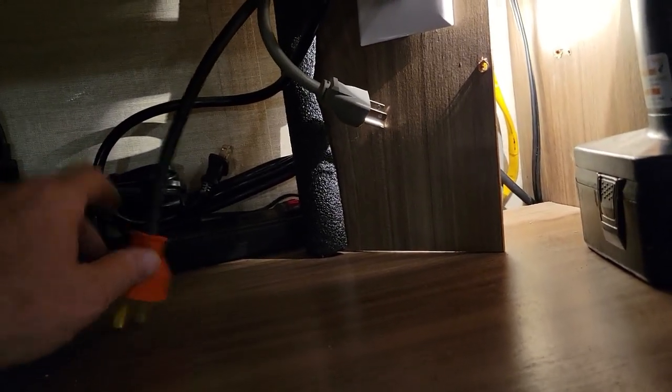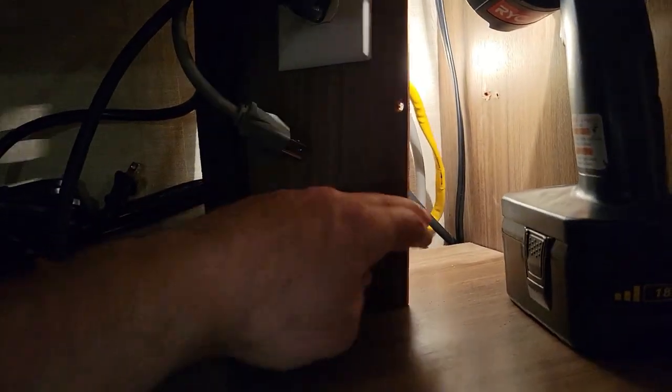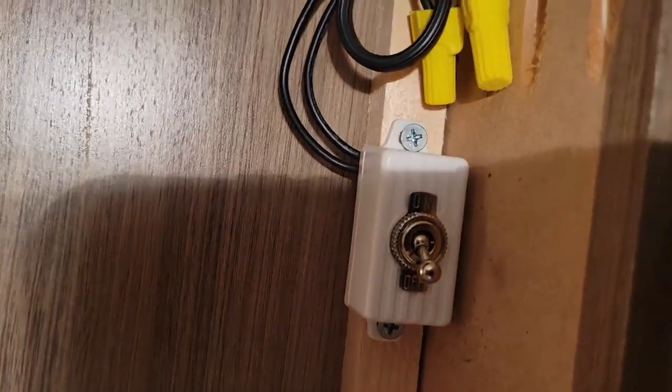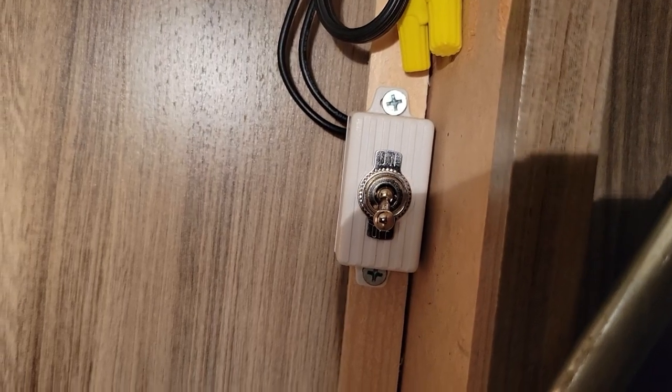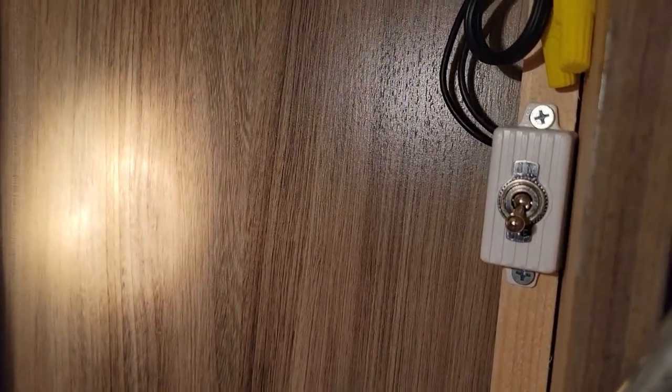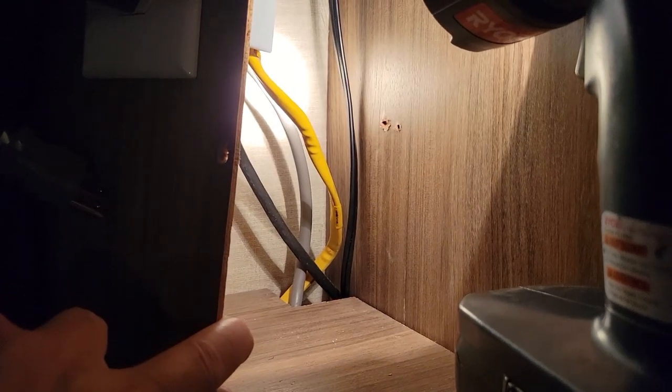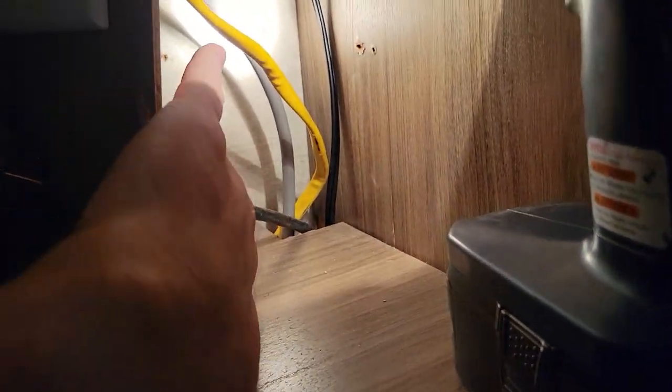I've got to fish a wire from here to behind the refrigerator which is right over here. I've already done it several times - when I put in that switch right there, which allows me to run my refrigerator and ice maker on the inverter while driving or boondocking instead of burning propane. I'm going to pull this existing wire out as far as I can, tape a fish wire to it, go outside to the refrigerator side and pull it through - and then I'll be able to get the coax cable through for the WeBoost. The white coax is now taped to the fish tape and I'm pulling it through - and there it is, pulled through.